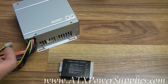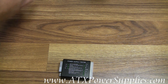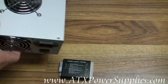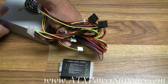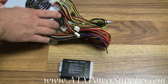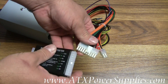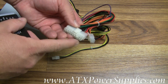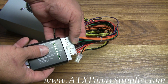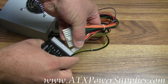Now I'm going to take a late model power supply. I'm going to remove this old 300 watt and bring in a late model 630 watt power supply. It's got all the fancy bells and whistles that people are looking for these days. I'm going to plug it in, turn it on, and hook it in to the tester. You see this is the latest type that comes with 20 and 24-pin connectors. I can plug just the 20-pin for a good test, or if I want to test my entire 24-pin connector, I can do that as well.